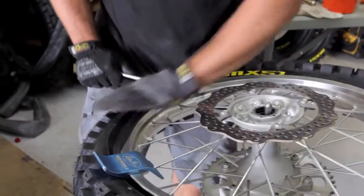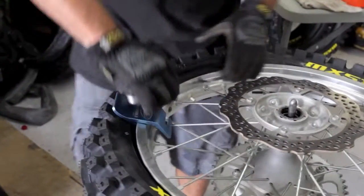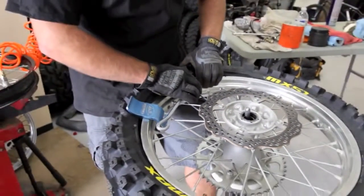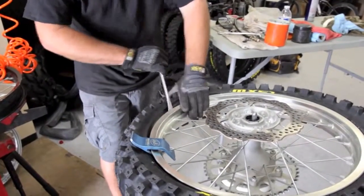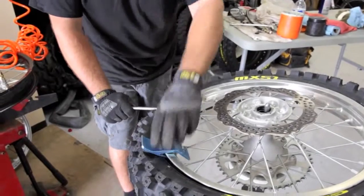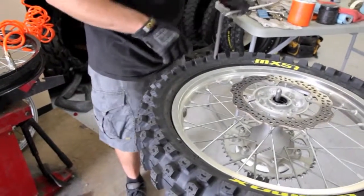And for this last one, when you can avoid this, you want to, with your leg, pick up a little bit and just work the tire spoon in for this last little bite, and then just drop her down. You can also use a hammer to knock down the last little bit. So you pull your Bead Buddy out, like so.